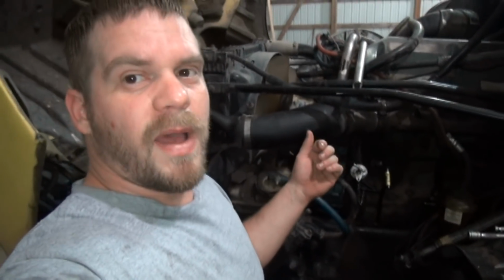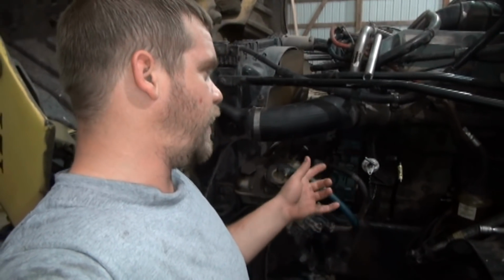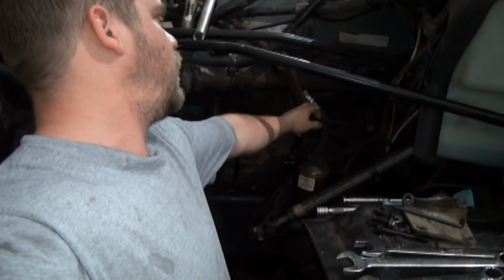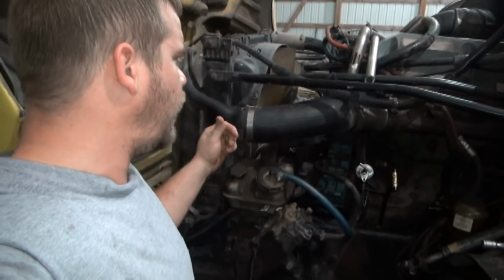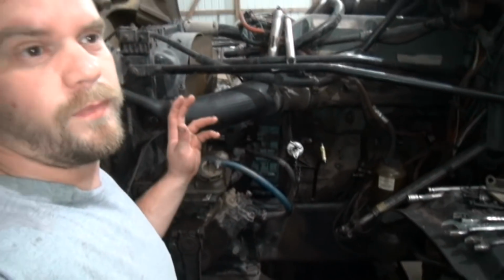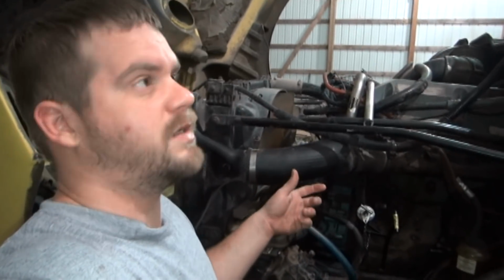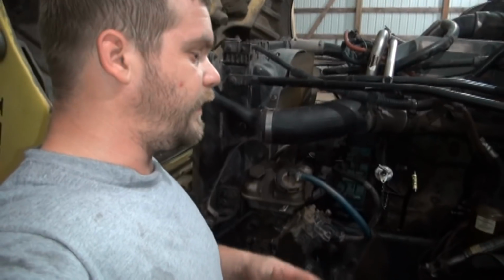But he couldn't get over about 80 pounds of air. And like I say, I connected shop air to the air hose here, going into the dryer, found the dryer bad, and got that all put on there and figured out we still couldn't get enough air. And he thought he was going to have a tow truck bring him in. It got so bad, but anyway, we're getting that all fixed up.